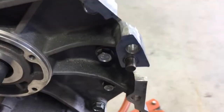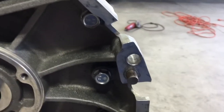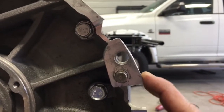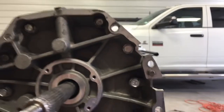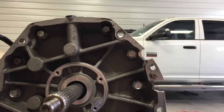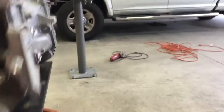The third thing we need to do — for most Supras, the IS300, and SC300 — is cut a little bit of the stock bell housing off right here. You can see how I have it pretty thin right here, and that's fine, it's not going to hurt anything. Normally this sticks out about another quarter inch, and that can cause some clearance issues. This bolt, looking at the front of the trans, is at about the three o'clock position, so that's the one you want to shave off.